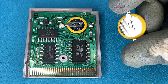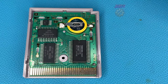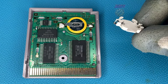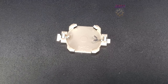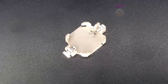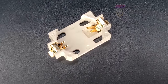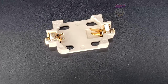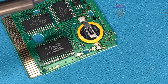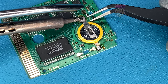There is a different method we can use here and it's actually a lot easier than the CR2025. It uses a battery holder like so — a nice white little plastic piece with prongs. All we have to do is get the CR1616 cell and slot it in, and you can pull it out of this holder whenever you want. The reason why the CR2025 doesn't have a holder is that the holder is absolutely massive and doesn't fit in the game cartridge.